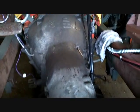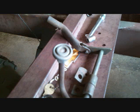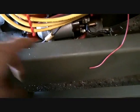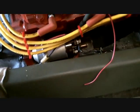Somebody mentioned, hey, it'd be cool to put the original floor starter switch on the floor when I get it together. And this is it. Now, normally, in the stove bolt 6, which was the original engine in this car, which mine was really junk. The whole head was full of rust, and it was really crap. Would have been a lot of money to rebuild it. This actually bolted to the back of the block, pretty much where the transmission holes are. And this little rod would reach down, and not because I have a solenoid, but on the old ones, it used to push this little switch, and that switch was on the top of the starter. You were manually jamming a solenoid. Actually, not even. I wouldn't even call it a solenoid. You were jamming a switch to the battery lead, and that must have been pretty creepy.